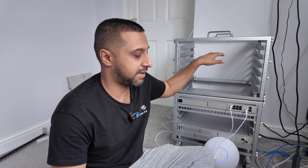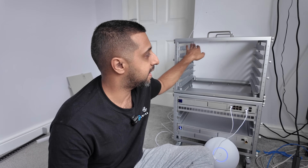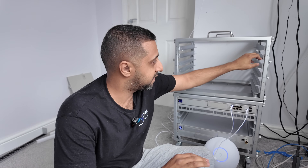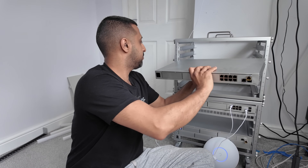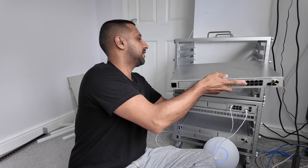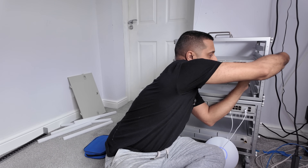Let's start racking everything. I'm leaving my top shelf blank for a virtual machine host I'm hoping to get a tool-less shelf for, and leaving a second gap for a future WAN switch. In slot four the UDM Pro Max sits right there - you seat it in the tool-less rack, screw the little side screw in and tighten it up. That's our gateway secured.